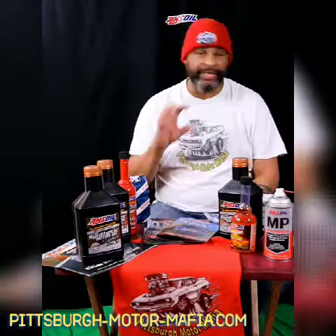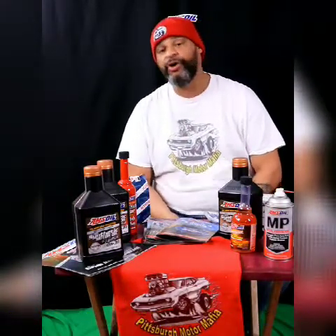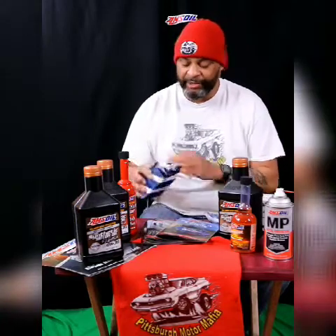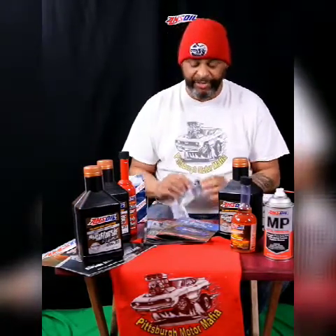All that simply means is that with these emissions systems they get clogged, they get dirty, they get worn out like anything else. The first thing you want to do is check your gas cap, because if it's not tightened all the way, something that simple will cause your check engine light to come on. I have two vehicles with the exact same problem — a Dodge Ram pickup truck and my Saab. We check the gas cap, it's tight, and we've replaced a lot of the emission parts. These are the last two pieces actually.